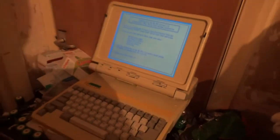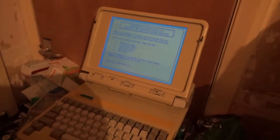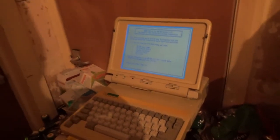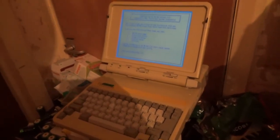There's no hard drive in there, but I think the floppy motors might always be running in this one, I'm not sure. We had to boot from the left floppy drive using the internal monitor because the right floppy drive's very intermittent now and the left one's starting to get there. Now, I said these might be proprietary, I can't get any other drives to work in there. Might be some weird jumpering on the drives that I'm not aware of, I'll have to look into it.